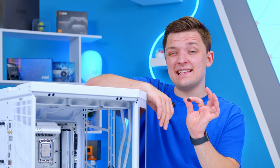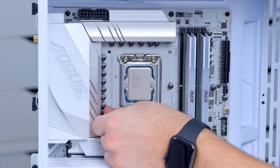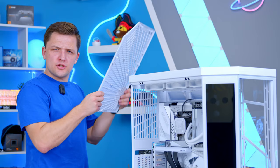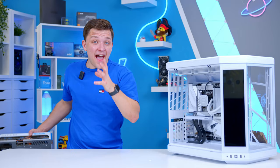Just the water block left for the CPU cooler. All that remains is to pop the back plate through the rear of the motherboard, then add four posts around the actual CPU area itself, then add the water block on top — remembering, of course, to pop on a dab of thermal paste for good measure. This is going to create that nice thermal bond between the water block and the CPU. Then pop the top panel on, and move around to popping the GPU in.